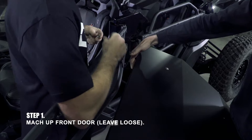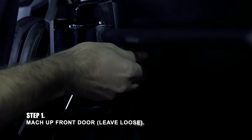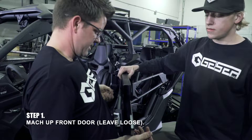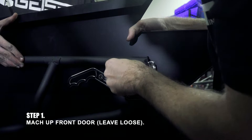The shim goes in between the door frame and your replacement door. When we get to the back, you'll do it a little differently. You want one of your stainless washers on the outside, put your shim in, washer, and just mock your nut up. We include a lot in the kit because we don't know how your car is going to fit up — you might not use any shims, or you might use all of them. It is strictly for alignment purposes. Do not tighten any hardware at all once you have the rear and back mocked up.